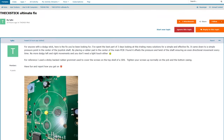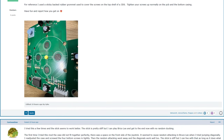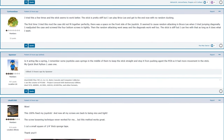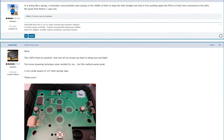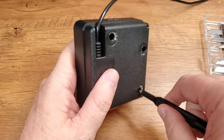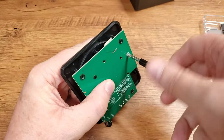So what do we do about it? No surprise, as is so often the case with this amazing Atari community, someone found a proposed solution and immediately posted it over on AtariAge. My buddy Jay sent me this link — I'll throw it down in the description for you. What they've done is put a small adhesive dot in the center on the PCB to create a sort of center post to prevent false positives when you're moving directionals. And though I'm not actually having trouble with my stick right now, I can understand how you could easily have that problem if you get a little energetic with that CX Stick. So I decided to tear mine apart and try this very fix.